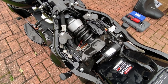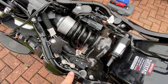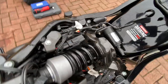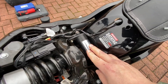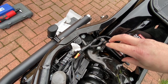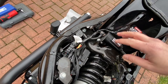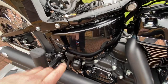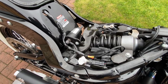The instructions say the first thing we've got to do is remove six bolts. Now you can see the issue we're going to have on the Heritage here. This is the external reservoir and this is where you adjust your preload. Going around to the other side, you can see it's bolted to a plate that's going to be removed, so the reservoir is going to be floating and not screwed down. What I've heard is that we can relocate it under here, so I'll take this off as well and we'll just see where we go from there.